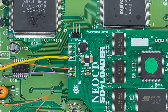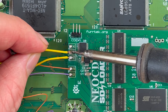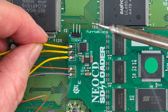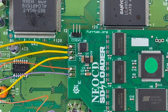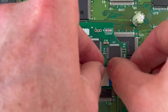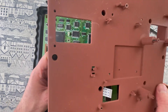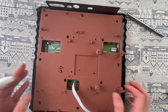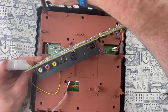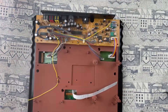I need to mention the three pins I just moved on this board. There is a three-pin connector that you remove when taking this apart — it comes off the AV board at the back — and that is the connector you need to connect to these three pins. I'm carefully fitting the ribbon cable, tacking all the wires down with Kapton tape, and then feeding the ribbon cable through the hole. The next connection is the CD audio cable to those pins on the mod board, which is very tricky — which is why I did it off camera and then put everything back together.